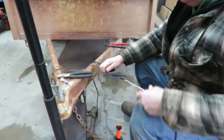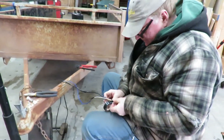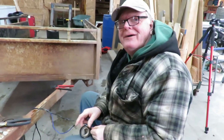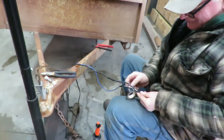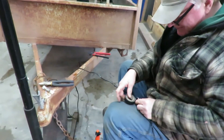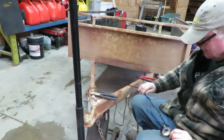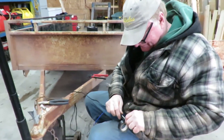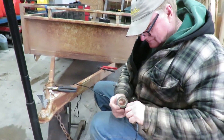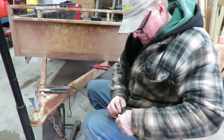Same thing I was doing before - wiring, putting new wiring on this trailer. Specifically, putting tape on the wire. And I extended the ground wire because it was very short from the harness. I just used what I had, which was blue. Blue is close to green, right? White. White? I thought ground was green. Depends - on trailers it's white.